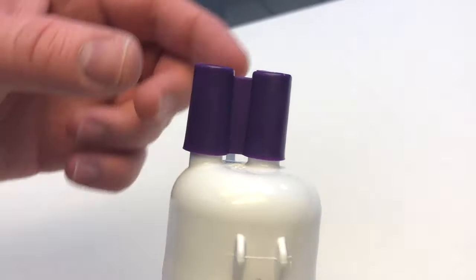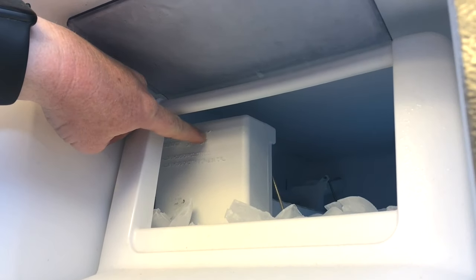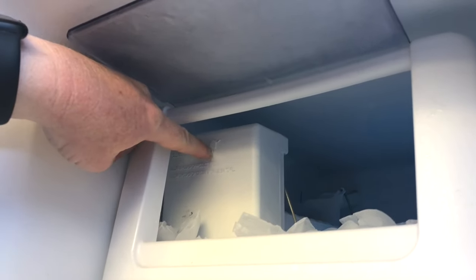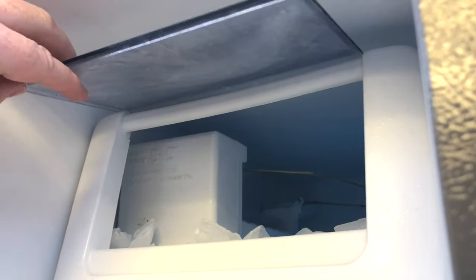It's really easy to replace. But before I put it in, there's one quick thing I want to do. I'm going to come up here to the ice maker — there's a little icon on there that says straight up is off. So I'm going to move the bar straight up, and that's going to turn the water off and make sure that the ice maker doesn't come on.